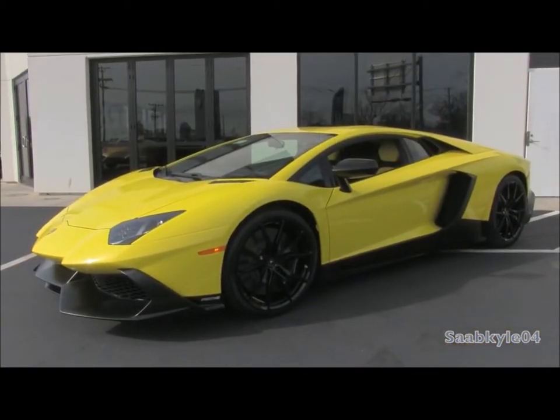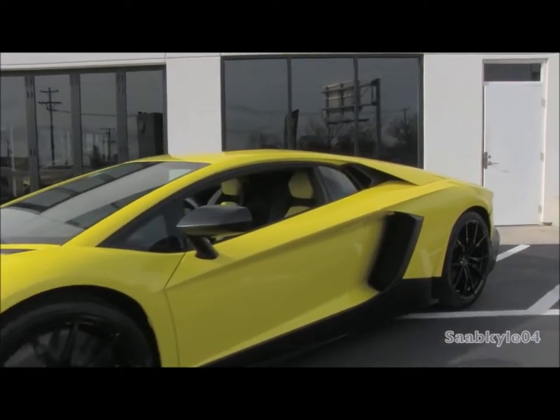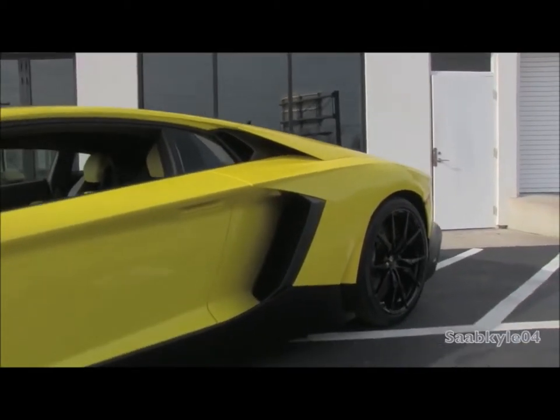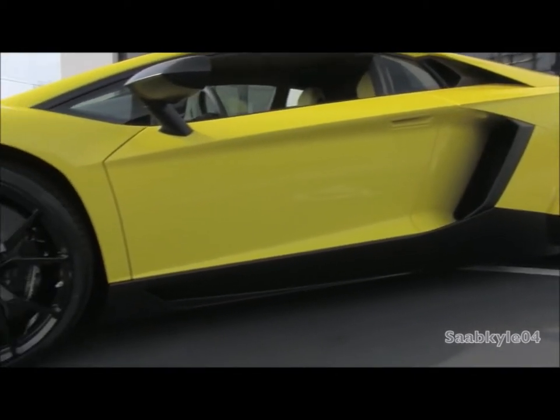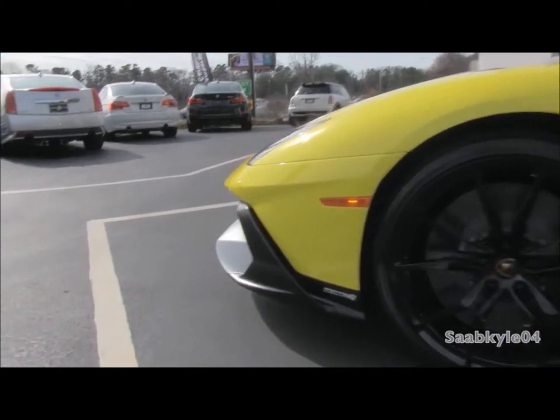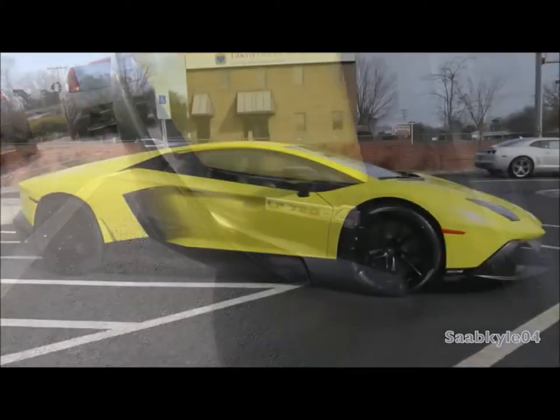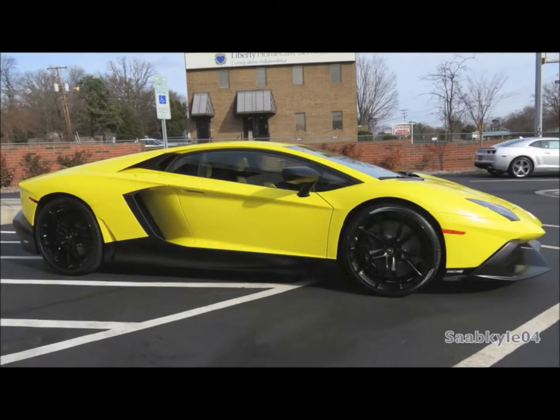The Aventador takes carbon fiber construction to a whole new level for the brand, significantly increasing its overall stiffness when compared to the welded steel tube chassis of the Murcielago. The standard structure is composed of a one-piece carbon fiber monocoque that starts life out as multiple sections of carbon fiber cloth that's precisely cut using a computer numerical control, or CNC-guided ultrasonic knife.